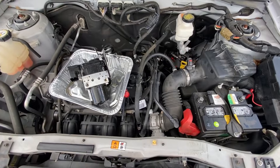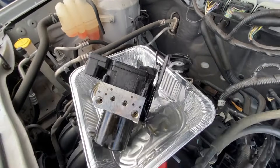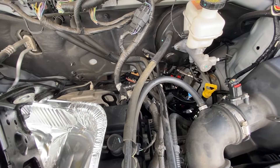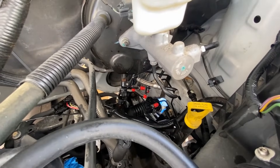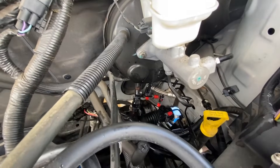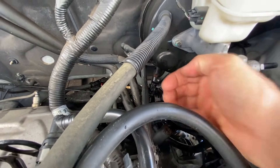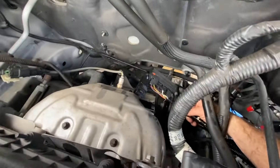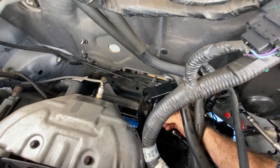There might be one more bracket to tackle and then we'll see if it comes out. The module and pump have been removed — it took three bolts and one nut. It wasn't extremely difficult, just cumbersome. A lot of the brake fluid has leaked out by this point but I've capped off all the brake lines. I did have to remove the brake line going across in order to jimmy the pump out — I pulled it out in that direction, pulling that line forward.